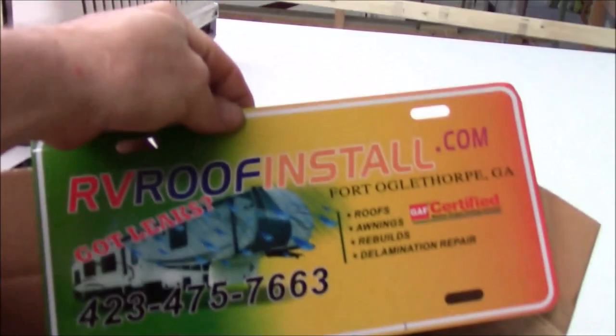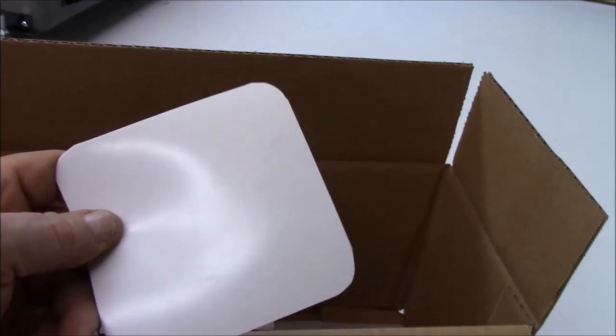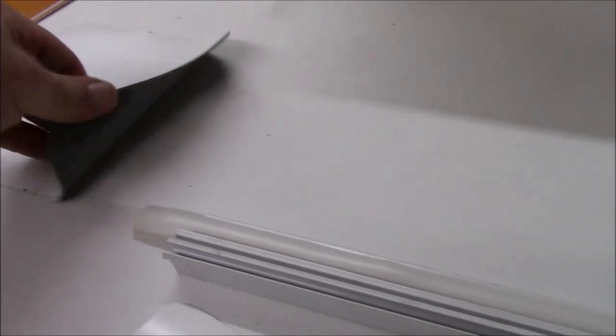All the coaches that go out get a care package. We've got a license plate if he wants to put that on, and a piece of patch — an emergency patch in case a tree branch comes down. This is a hot patch, the same material as the roof. In an emergency, if you had a hole you'd shove this in and squirt the Chemlink moist-cure product all around it in a circle and load it, then squeeze — it'll bubble up and seal it. We also left a couple of patches. The way you want to do your patching: center it over your hole, take a pen and outline it, then set it aside.